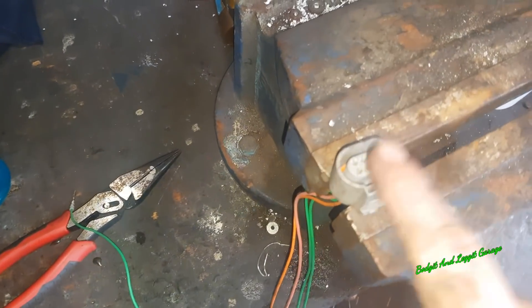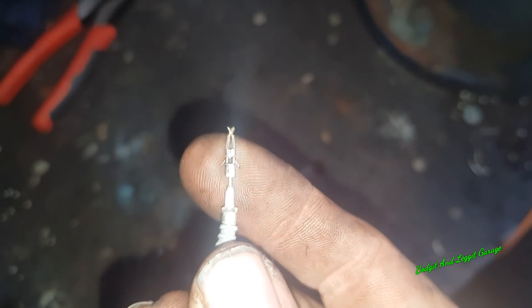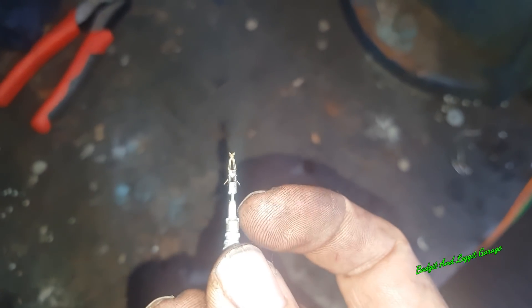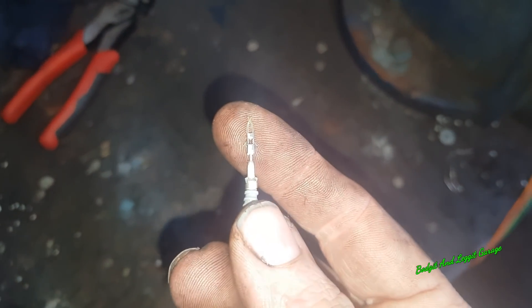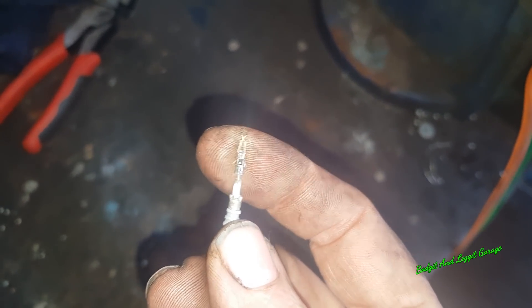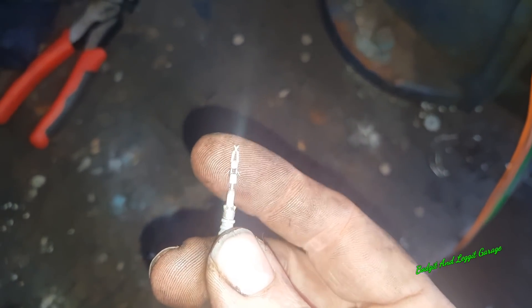I can bet you it won't be as easy taking it out of the one on the vehicle. You can see those two little wings I've just pulled out — the two little tabs. I got a blade underneath there — just a Stanley knife blade and just bent them out. Now once I push it in, it will push in and click. They push past the little lip and it means you can't push it back down — it's like a barb on a hook. That's exactly how they work. You need to go down the side of the pins, not in the middle, because you'll just open it up and destroy the pin.